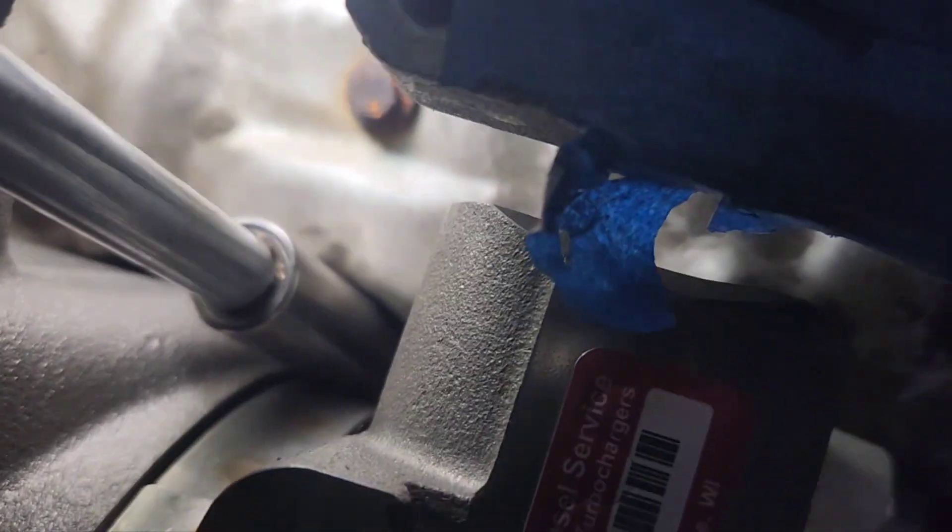Driver's side back bolt — I used that same 13mm and it got stuck for a little bit, but I kept prying it just slightly. The heat shield is very soft, obviously, but once it made it through after prying around with the socket and extension, I was able to drop the bolt in there. It's nice having a magnet piece — drop the bolt right in, and now I can grab it with the extension.